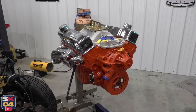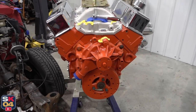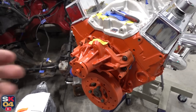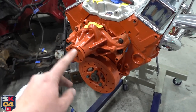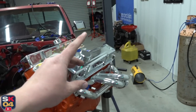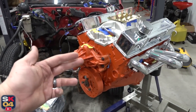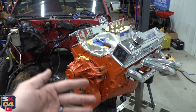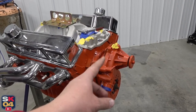In those cases, you would either need to somehow modify the stock oil pan or find a company that makes a dedicated swap oil pan with a lot more clearance up front. My second concern is with the radiator. I'm going to be running a Corvette radiator, which I'll show you a little bit later in the video, as well as a pair of electric fans. Problem number one is this water pump — this is what's known as the tall water pump. It sticks out a lot further from the engine than the short water pump, so that's going to get replaced. I also have a different harmonic balancer because the entire accessory drive off of the 4.3 V6 will bolt on to the 350, so instead of using the old-style tensioners and V-belt system, there will be one serpentine belt with an automatic belt tensioner. I still need to make sure there's proper clearance between the short water pump and the fans.